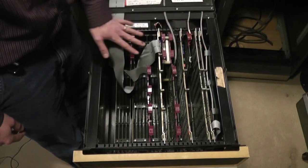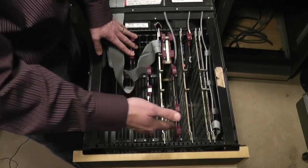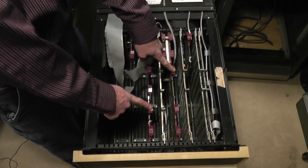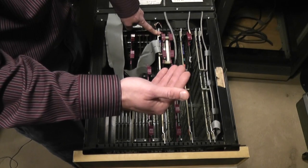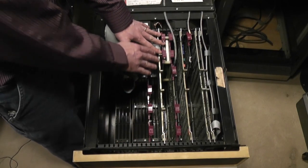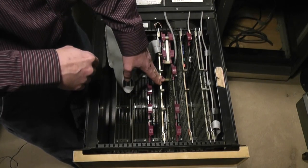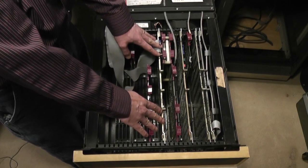Down here, these remaining four fingers are what we call SPC slots — Small Peripheral Controller slots — and most of your I/O devices would plug into those slots. Here, for example, is the floppy drive controller, and here is a terminal controller. Some larger devices — typically for power handling and mechanical reasons — would plug into all six of the slots, both the unibus slot and the SPC at the end. This is the hard drive controller — it's like that. An older version of this hard drive controller was two boards that went beside each other to have the physical space for the chips.